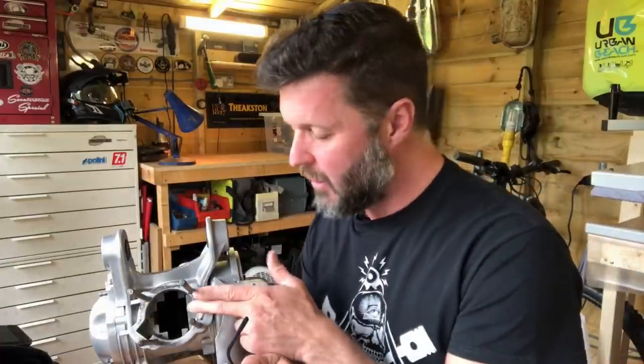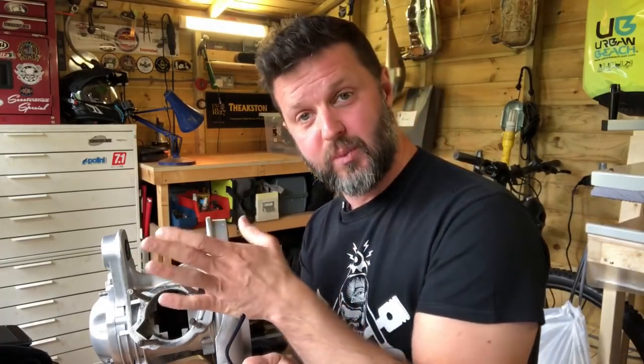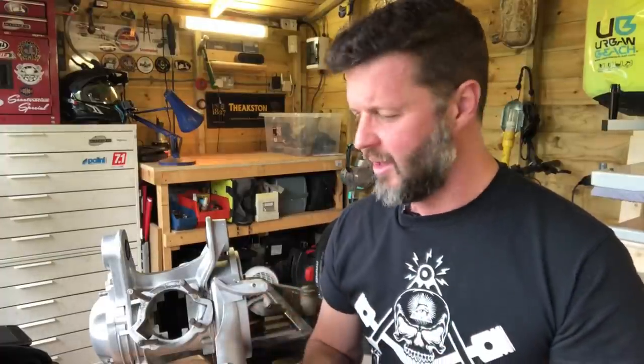Getting everything widened out, doing the same to the packer plate and to the kit. Daryl left it completely standard. He left the base transfers on the RB250 kit completely standard, and he had a big thick 9mm packer plate which goes beneath the kit, between the casing and the kit. And it masked something like a third of the transfer port on the base of the cylinder. So you had almost like a huge step for all the gases to try and flow around. It would go against every single one of your engine building principles. If you were building an RB250 trying to get 40-plus horsepower - not doing anything to the casings, not matching the kit to the casings, ignoring the packer plate obscuring 30% of the base cylinder transfers - he built the engine like that and kicked out 43 horsepower.